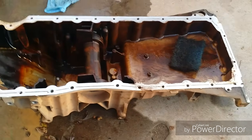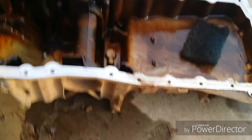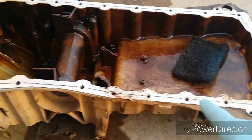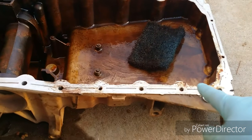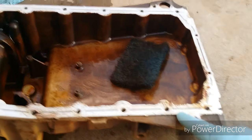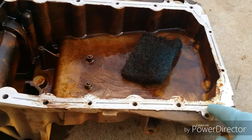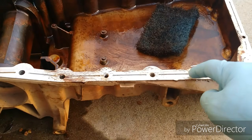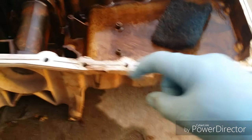So I wanted to show you the oil pan now that I had it out. I've actually done a lot of cleaning on the mounting surface already. Scraped all the gasket out of the grooves. I'll show it when I'm done before I slap it in there, but I'm going to put a bead in the groove and then a circle around each bolt hole and a connecting bead.